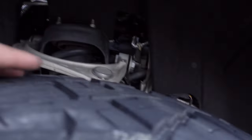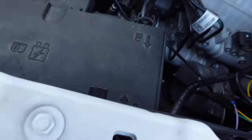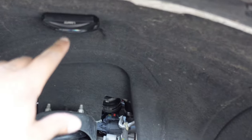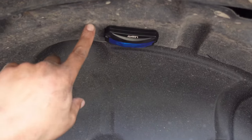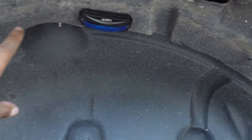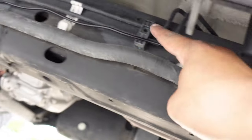Quick update — I decided not to mount the front one in that original spot. You want to be careful because there's a fuse box right above it. I just took a couple clips off and I'm mounting the light directly to the actual fender. I'm not using the rubber pad because that's adding time I don't have. For the back one, that was pretty easy since it's the plastic liner. I took off two clips, pulled it down, marked my holes, drilled them, mounted it, ran the wire down the bottom and across the frame rail all the way up to the fuse box area.